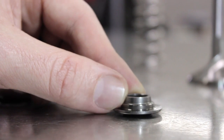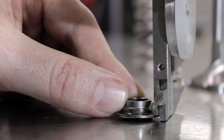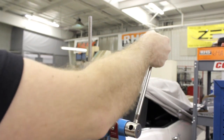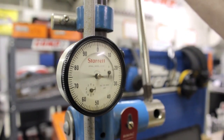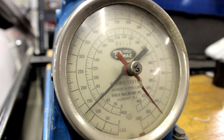Now let's talk about spring loads for a minute. If you've bought a new set of valve springs from CompCams, they've been matched for load consistency — this means all the spring pressures are within a tolerance of each other. If you didn't get your springs from us, or if you just want some peace of mind, you can use a spring checker to ensure that your loads are within 10% of each other. First, measure and note the thickness of the retainer from its highest point on top of where it sits on the outermost spring. Then place the retainer and spring on the base of the spring checker. Compress the spring to the desired install height, taking into account the thickness of the retainer that you measured a moment ago. This dial gives you the spring's force.